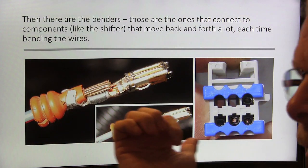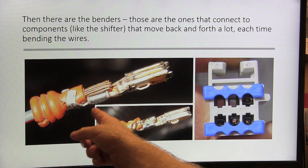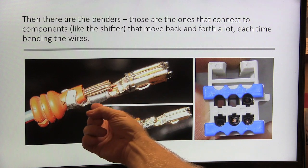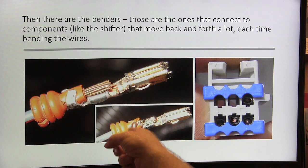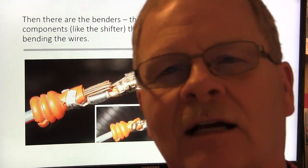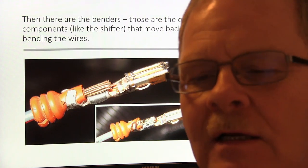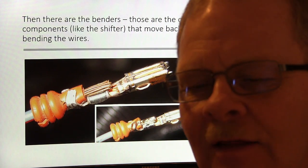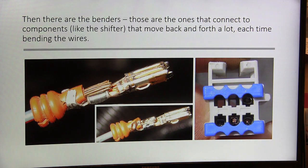If you fix this the right way, you can do it so it looks surgical and factory. I took these out of there — rather than uncrimping it, I just opened the crimp up, laid that wire real close along what was left of the old crimp, and soldered it. When you do it right and put your weatherpack back on, you can snap it right back in there just like it was originally. Then typically I wind the wire up in a coil so that when they're doing that motion, the coiled wire takes up the bending and it's less likely to break again.